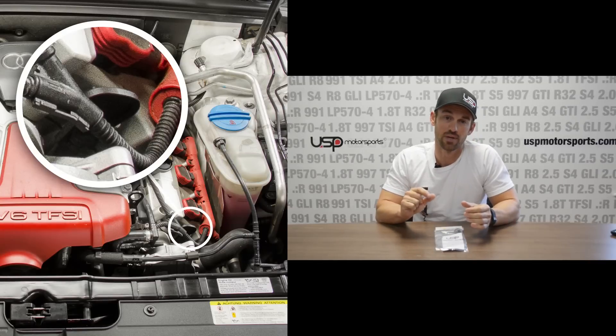Some of you might be watching this video saying, 'Well, my car has a dipstick.' But some of the newer Audis do not have dipsticks. All the newer Audis — anything from 2010 to 2013, 2014, 2015 — the majority of them do not have dipsticks. Any of you 3.0T guys will know that if you've ever tried to check the oil, there is a small plastic cap that sticks into that tube. You pull it out and there's no dipstick on there. The cars do have a low-level indicator, but if you're stuck on the side of the road with low level, you don't know how much oil to put in.